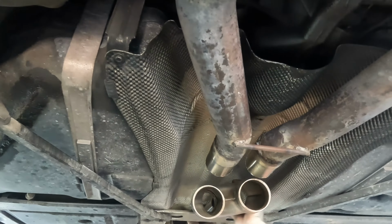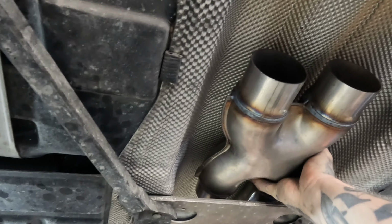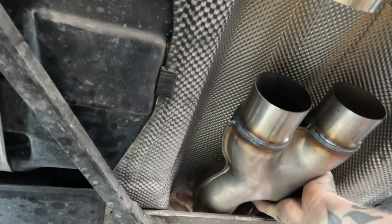I'll probably still oval it a little bit for clearance. Run this pipe, this X goes all the way back here, and then run this from here. Well, if that's up, can that go down a little bit in the front? It could go down a little bit in the front, but the thing is, we've only got a total of 3/4 inches. I was just gonna say, if that pipe's longer, you have lots more clearance on that. If that X is back, I think. That's what I'm thinking. Keep the pipe round through here.